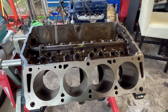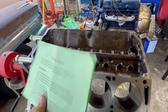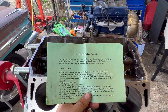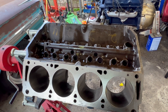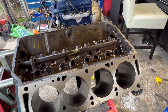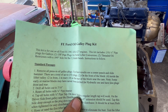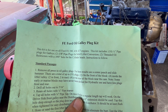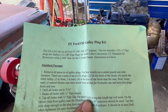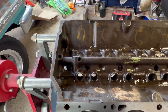So what are all these oil modifications that everybody always talks about on the Ford FE? Let me start out by showing you guys the oil plugs. I bought an oil galley plug kit from Precision Oil Pumps — shout out to Doug the owner, he's a really cool guy, always had very good answers when I called with questions. There are 10 quarter-inch pipe plugs, two one-eighth pipe plugs for the solid lifter conversion, and also included are the restrictors for the heads. I'm going with the Edelbrock aluminum heads and that's a 0.090 restrictor for that.